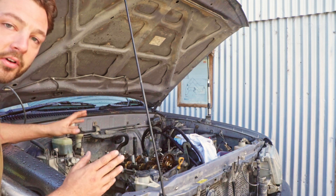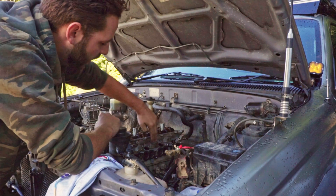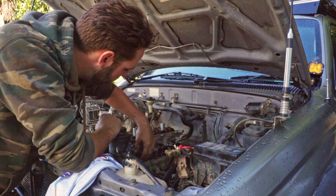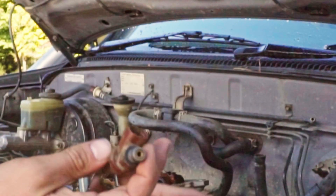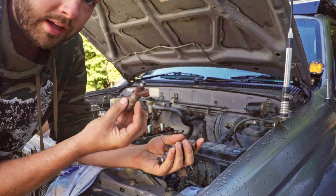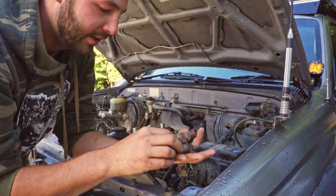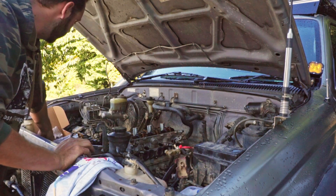Finally we've got gaskets and we can start putting things back together. The fuel rail runs along above our intake valves — they squirt right into the eight intake holes. I've already removed it all and here are our old injectors. They are scungy and scody — they've done the job but the seals are looking dry and worn. Who knows if they actually spray properly. Most likely these are the injectors from 1996 when the vehicle was built, so they're probably well past their due-by date.